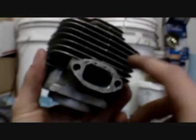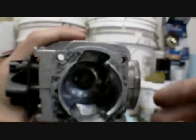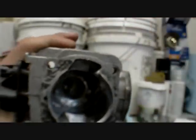Same thing here. If you just create them bigger, yes, you might get more airflow, potential airflow, but there's not enough pump that the cylinder is producing to really get that velocity. That pump that the cylinder is producing is all the power that you have to work with. That's your limit right there, the cylinder pump, the cc of the motor. So by matching it with that and making it so that the air is directed, you get way more power.